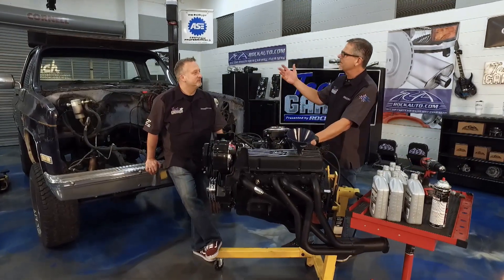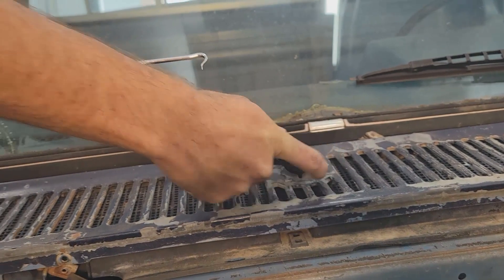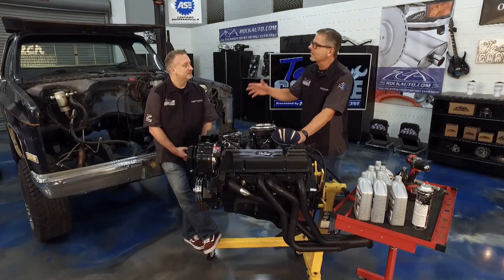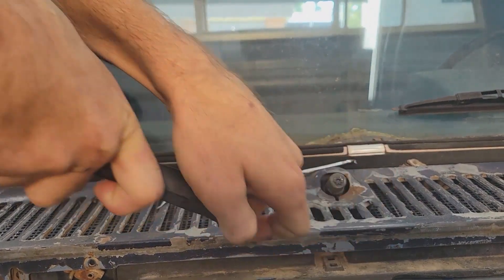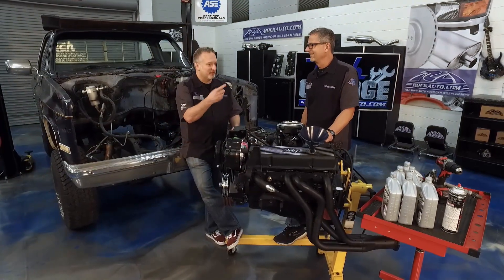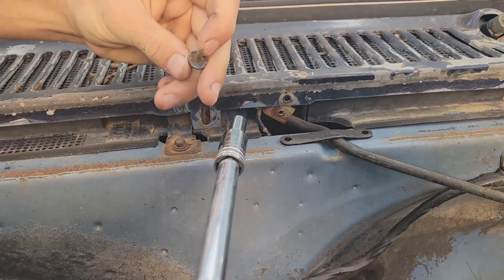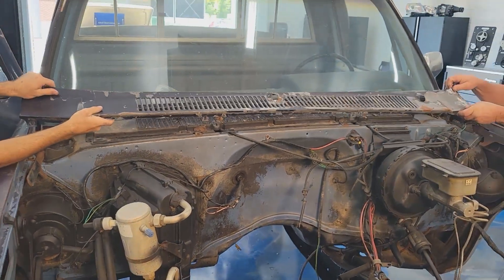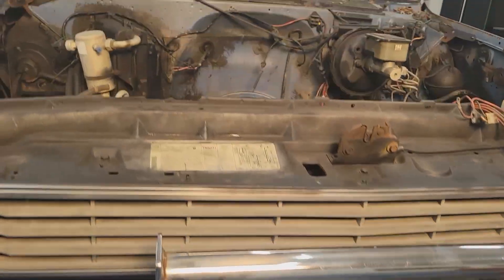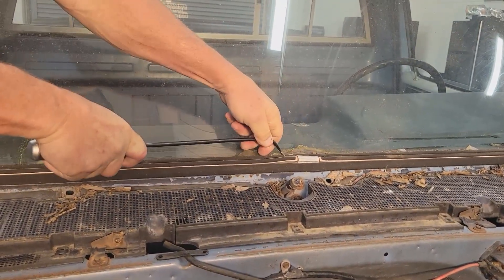But before we jump on this, let's turn our attention to the windshield. A lot of people don't get to see windshields installed, so we're going to go through the process. We called our buddies over at Tommy's Autoglass, local here, and Jonathan Fuquay hooked us up with the windshield. Gary Stevens, an incredible installer with Benjamin, did the job. First thing you got to do is remove the windshield wiper arms — those things have been on there for about 40 years, so it took a little doing. Got a little pick in there to pry the clips and they came off. We removed the cowling to clean it up and get better access to the trim. The molding around there was holding the windshield in, and it's brittle and old — the seals are the first thing to go, so we knew we were going to throw that out.